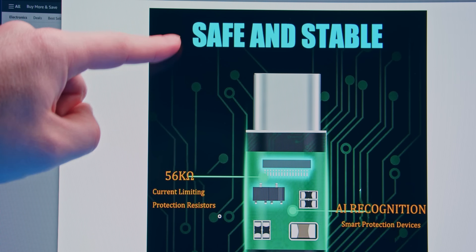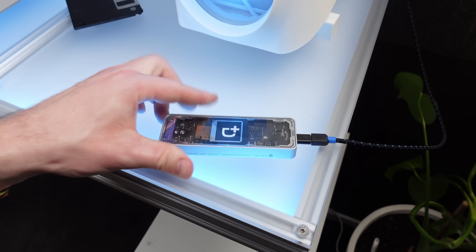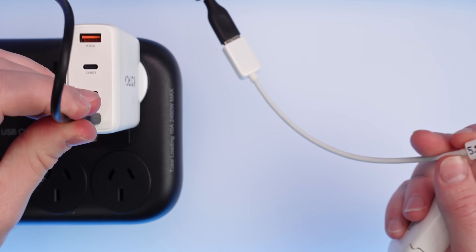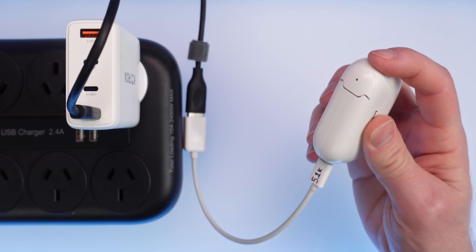There we go, that's the two-minute tip. A couple of disclaimers: obviously, user-owned risk — if you buy cheap cables that have the wrong resistors, there could be issues. I also only get USB 2.0 data transfer speeds with my combos on hand. Finally, these are directional, so if you put the wrong end into each device, nothing will happen as the resistors just confuse them.